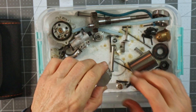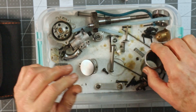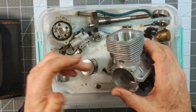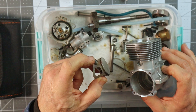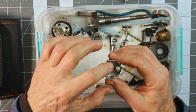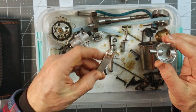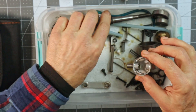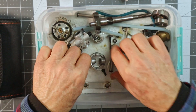I want to talk about wrist pin or piston pin extraction on the piston of these OS Surpass engines. As many of you know — or may not know, but you'll know here soon — the only way that you can get the connecting rod off of these Surpass engines is by pulling the sleeve out and then extracting the piston pin from the piston through this hole. That's the only way because there's just not enough room to move the piston to move the connecting rod off the crankshaft, especially when it's a crankshaft that's got this extra stub attached to the pump. On the FS20 or maybe the 26 Surpass you can, but anything above that you pretty much have to extract this piston pin.